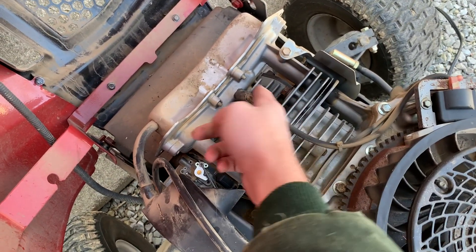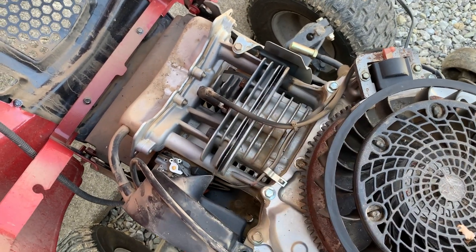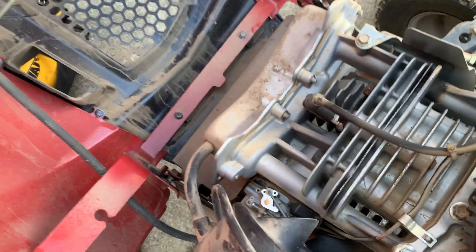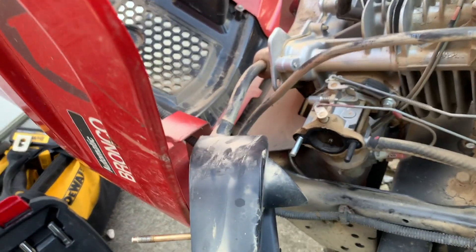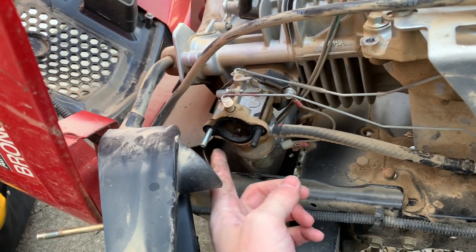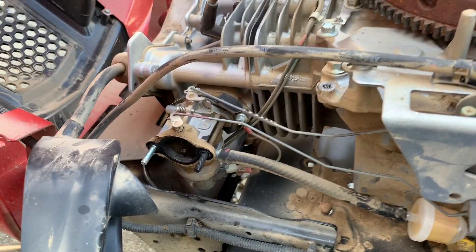The coil pack - if that ever goes bad, pop the cover off, take your spark plug out, put it anywhere on the steel head, put the wire back on it, hold it, and try to fire the engine - you can see if there's spark. That was one of my test things, but right now everything's good. The carburetor's right down there. The air box was easy to get off. It's still attached by a hose - I might just bend it out of the way. The left side of the carb is held with one of those 10 millimeter nuts - I had to use a box wrench. The other was inside the air box and the third spot was up here under that cover, so it's only in three places.